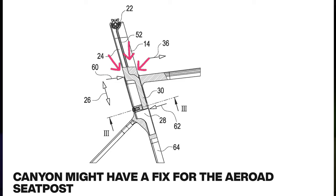The seat post is going to be moving up and down slightly at the back of the receptacle where it goes into the frame. This is going to create some wear, and depending on how heavy you are or the terrain you ride, you might actually get wear at the back of the frame where it comes out, because that's going to be the point of most flexing in the S-section of the seat post.